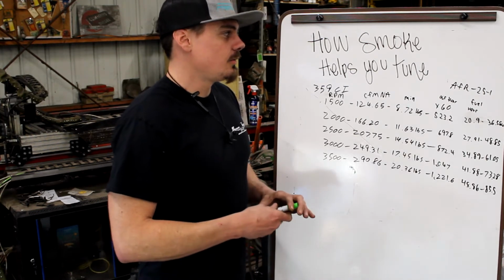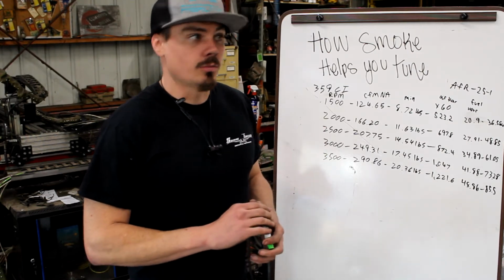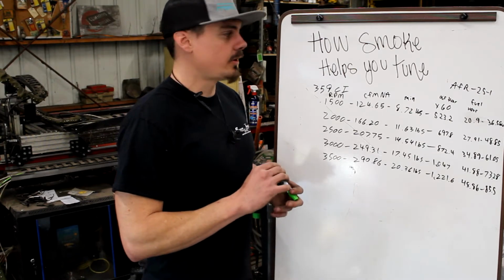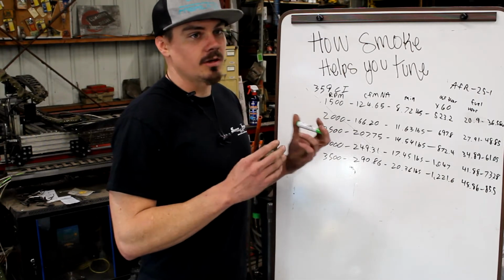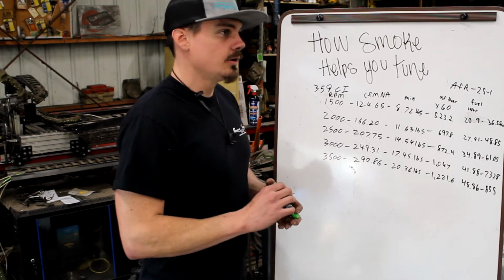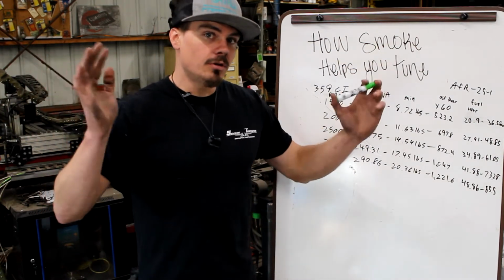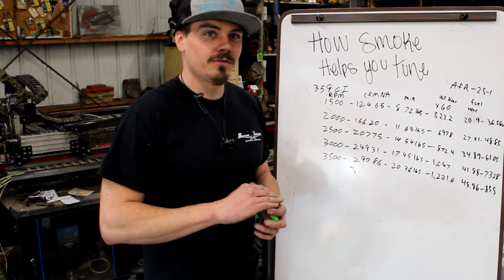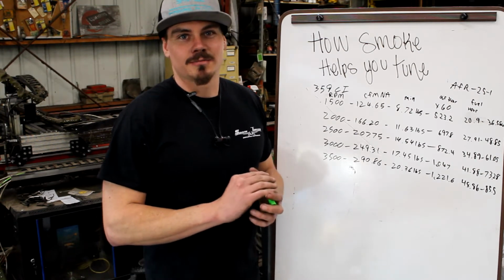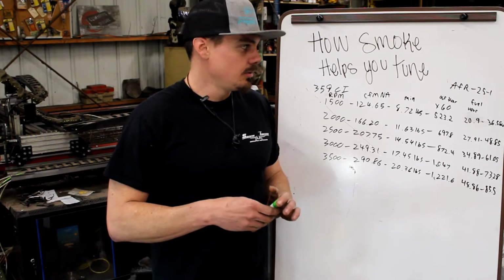And then there's the other spectrum where, to make the AFR go up, we have run out of turbocharger, or we should say, compressor capacity. Say a system that may need 700 pounds a minute to run 35 to 1 AFR. The turbocharger to do that is going to be absolutely huge and will not fit inside of an over-the-road light-duty diesel truck. So stuff gets really, really big and then just kind of stops working.